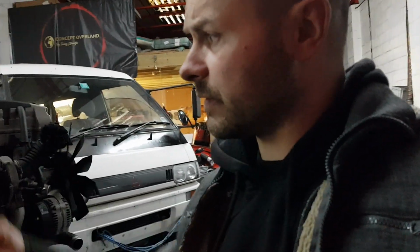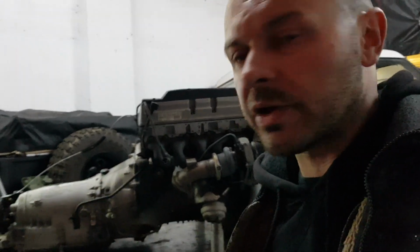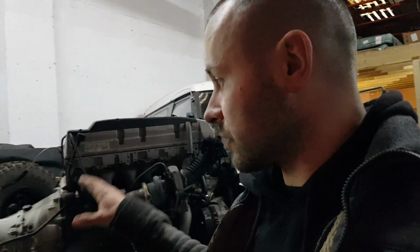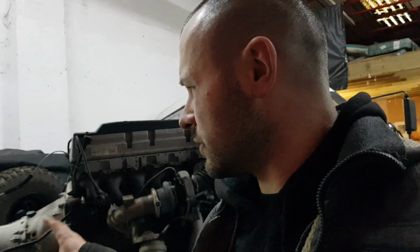The gearbox itself is very durable, it's very strong. All you have to do is increase oil pressures. You have to put a big oil cooler, obviously, to keep them cool and all that stuff. But you can really make them really reliable and strong. They take twice the amount of power this engine can ever produce, especially if you modify them, because you can. This is actually the same gearbox they use in AMG, obviously with a different clutch pack, with a different torque converter. But again, this is all stuff you can do in the future.